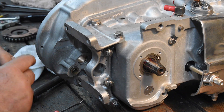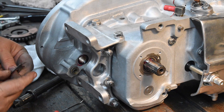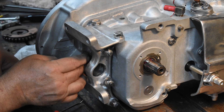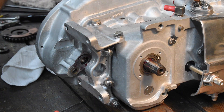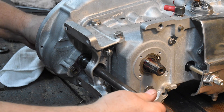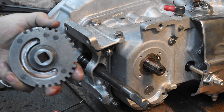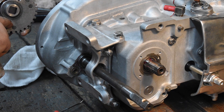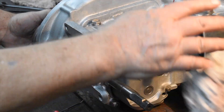Put a little grease on the washer and stick it in the hole. Put a little grease on the thrust plate just to hold it in place, then stick it over the hole. Stick the kickstart shaft in the hole — remember, the slot for the bolt goes up. When you orient the kickstart gear, you've got to orient it so that the stop pin is up against the bottom segment. When you kickstart, it'll come around this way, and the bolt hole aligns with the kickstarter arm so the arm will go up with the bolt on top.